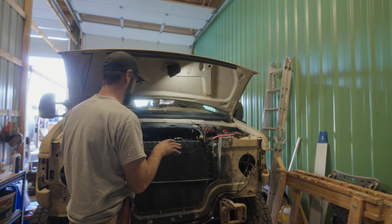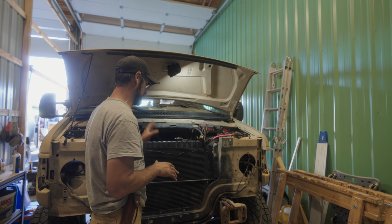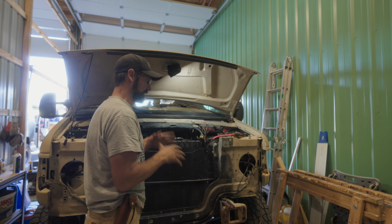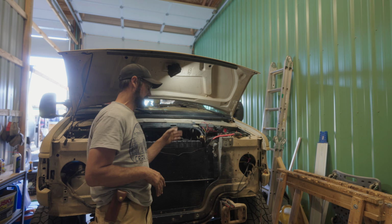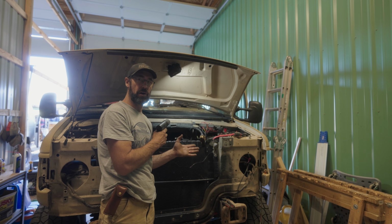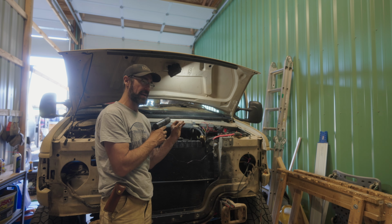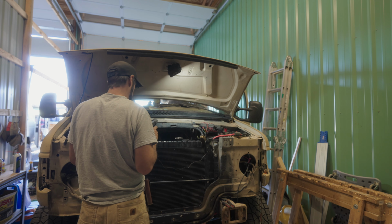Alright guys, so we don't have everything together obviously, but we have the van together enough to where we can start it and start testing everything and make sure everything's good. Now like I said, I've already pressure tested the radiator system, so I'm feeling really confident that that's all good. But if there is anything that's not quite right, I didn't want to have everything on the van and then have to tear everything back apart to be able to get to it. So we're going to do some testing now. The first thing I'm going to do is Megan's going to help me. She's going to start the van, and I'm just going to double check the timing and make any minor adjustments because we did put a new timing chain on it. Should be pretty close, but I had it a little bit advanced before just because it seemed to lug a little bit. So I'm thinking with the new timing chain, I want to get it back to top dead center, or 10 degrees, which is what it's supposed to be, and have it at that and see how it runs there for a while. Okay, let's try it.